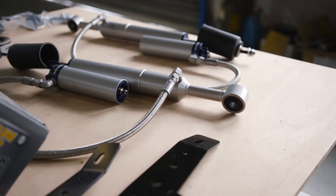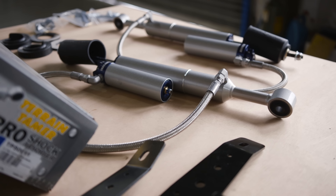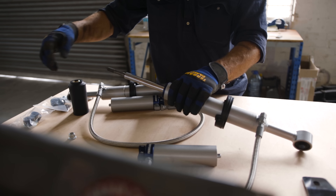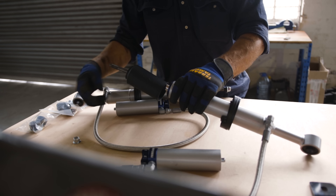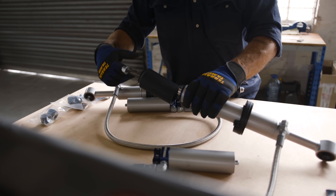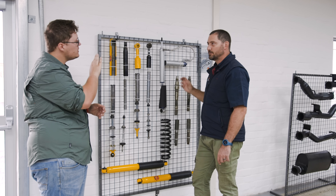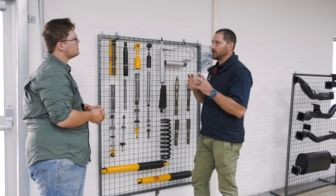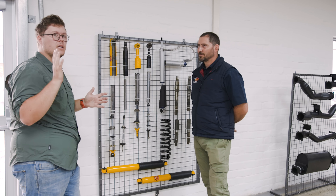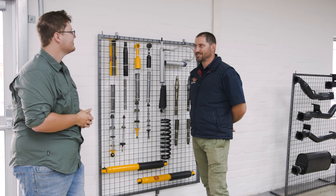That makes total sense. So basically putting the oil under pressure assists with preventing the oil creating bubbles on the inside - it's like water cooking at a higher temperature at sea level than in Johannesburg. Here you just put the oil under a lot more pressure. Due to the manufacturing involved, it's very difficult to get the pressure you can put in your pro shock into a twin tube shock. We work with 150 psi, where it's a lot lower in your twin tubes. What is inside there that's adjusting - is it different shims? It's shims, basically the valving, so you can make it softer and harder. I think Nicky is pretty much done getting the old stuff out, so maybe let's head over there and see everything going.